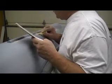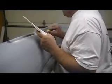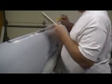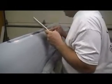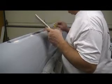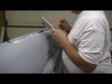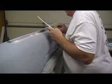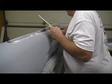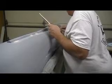I'm gonna sand this and put some primer on. There's no need in trying to primer it up before this — it's just wasting primer. I don't like to shoot primer until I know I'm ready for it. Otherwise you just gotta sand it off and wait for it to dry. It's just a waste of time, waste of bondo, waste of primer.